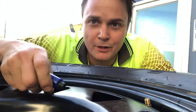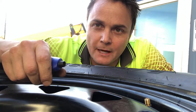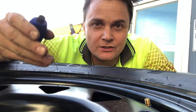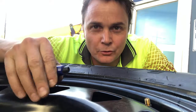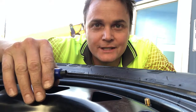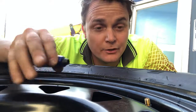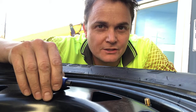Let's talk about tyre pressure. I've gone for 35 pounds in the front. I actually go for just 30 pounds in the back of my ute because it's such a lightweight thing — pretty much all that's on the back is an aluminium tray, the drawers are a bit full, and I've got a little bit of stuff on the roof, but I'm generally travelling pretty light. So 30 pounds in the back seems to even out the stiff leaf springs just a bit.